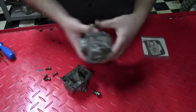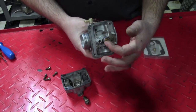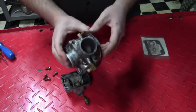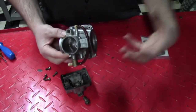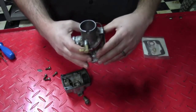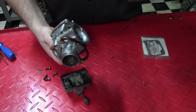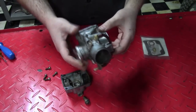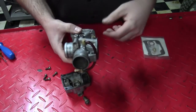That depressed portion is sealed by this o-ring, and this is where the jet needle fits down into. The jet controls how much fuel is allowed to flow into this portion and up into the area where the jet needle rides. Another interesting feature, because this carburetor is in a sealed compartment within the engine, is that all the vent hoses have to be interconnected and run out through a grommet in the case — you'll see that later. There's also a vacuum line that operates the fuel shutoff.